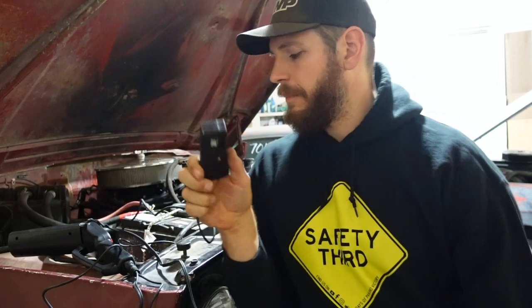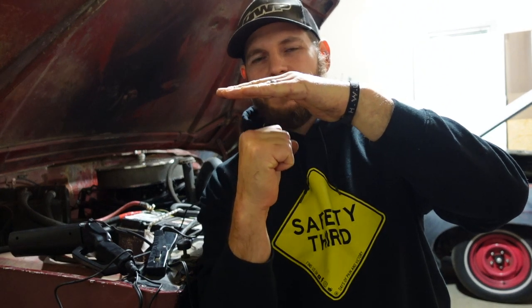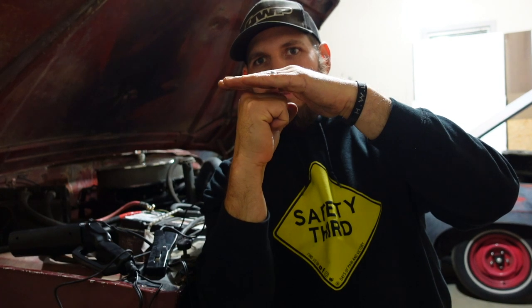When you're hooking up your timing light, you're going to hook it onto the number one spark plug wire. You're always going to set your timing advance to a certain degree — you'll have to look at your specific engine's needs, whether it's high performance, stock, et cetera. But it's always going to be a little bit advanced, because as your piston's coming up in the cylinder, you want it to fire before it gets to the top. If you wait until it gets all the way to the top, you're already too late — by the time you get that flame, the piston's going to be on its way down and you're losing power. That's especially true in high performance motors at higher RPM, because that piston's moving so fast that by the time it sparks here, it's actually going to ignite there. We're set at about 11 or 12 degrees on the Jeep.